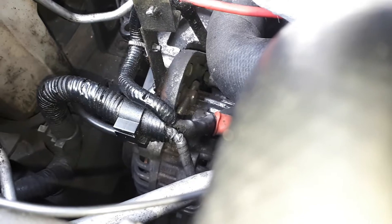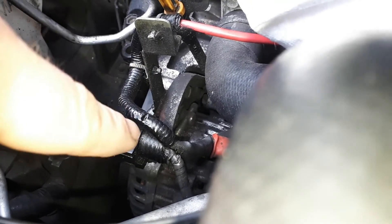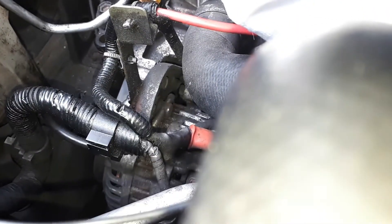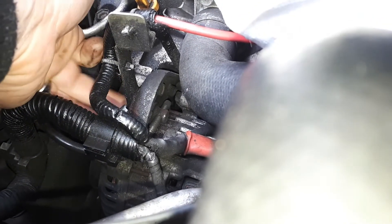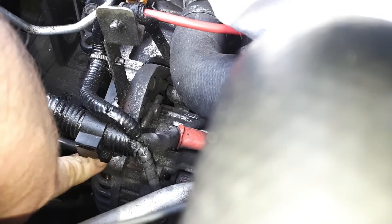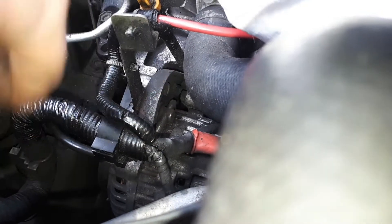The alternator only moves backwards and forwards as much as that bolt allows. There's a head of the bolt just underneath the wiring loom here — it's 12mm as well. So you loosen the bolt on the side, which is attached to this side of the bolt. And then by maneuvering this bolt, you're moving the alternator backwards and forwards. Wind this bolt anti-clockwise to loosen it, allowing the alternator to work its way back in towards the engine and slacken the belt. That's our alternator belt.